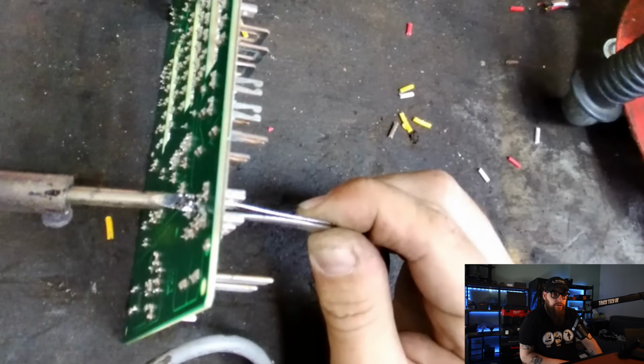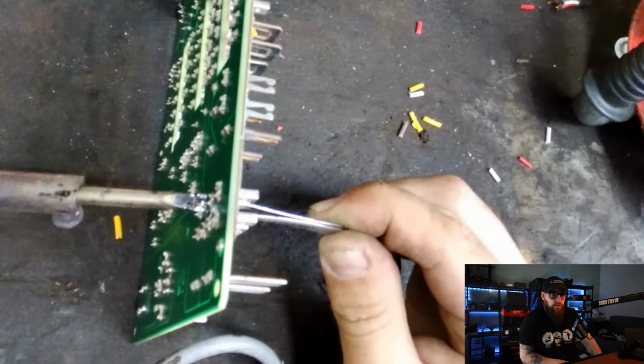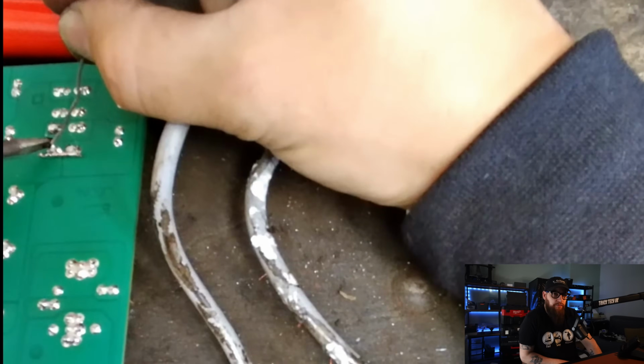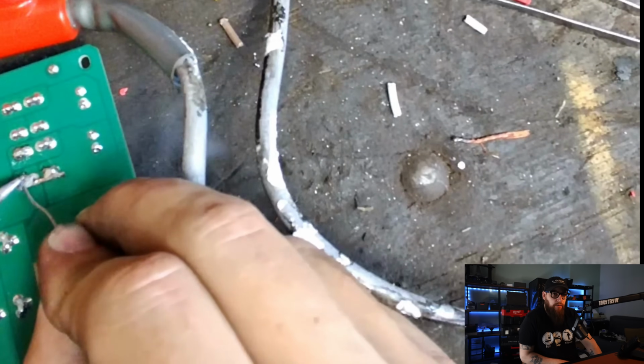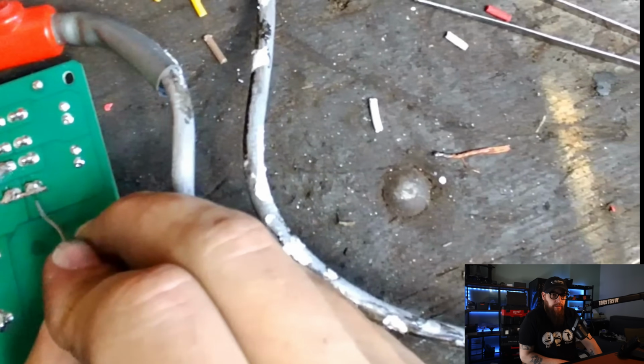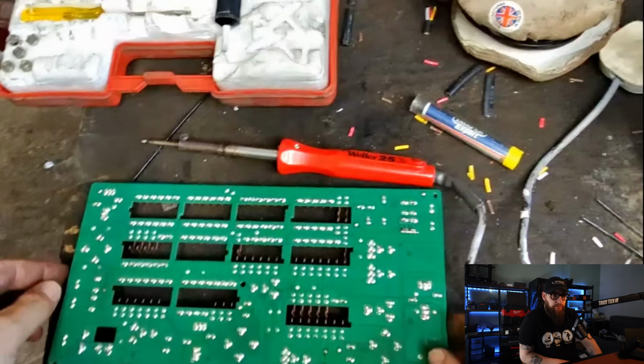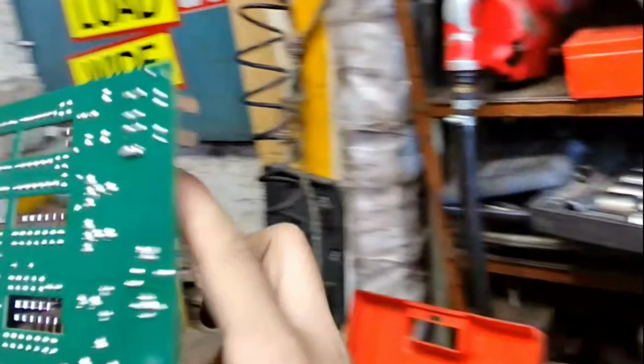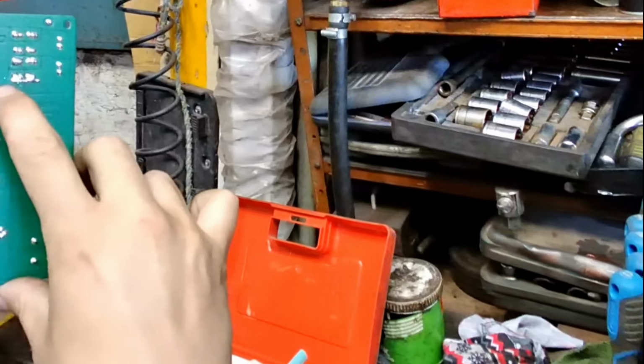So we're going to bridge this contact over to the next fuse on the board which isn't used. With the board repaired and the fuse holder next to the original one now our wiper fuse holder, we can get this back together and throw all the fuses back into the fuse board. So now I've done this here, so we've just jumped that across.